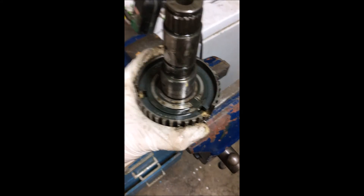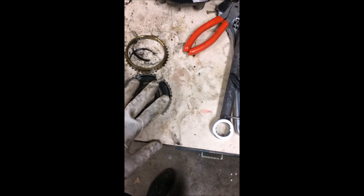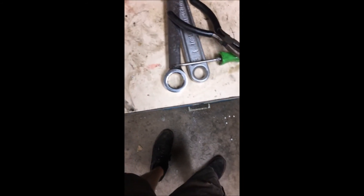I needed two hands for that, so I'll be right back. You don't have to take this off first, but this little spacer ring - it's directional, it has little teeny-weeny divots in it. It can go on both ways, but it goes on this way. There's no machined indent on this side, so this goes on the shaft like this, and then that fits on there. The synchro goes on right here. Be careful when you're taking this off - there are three of these little springs that can go flying, so just be aware.